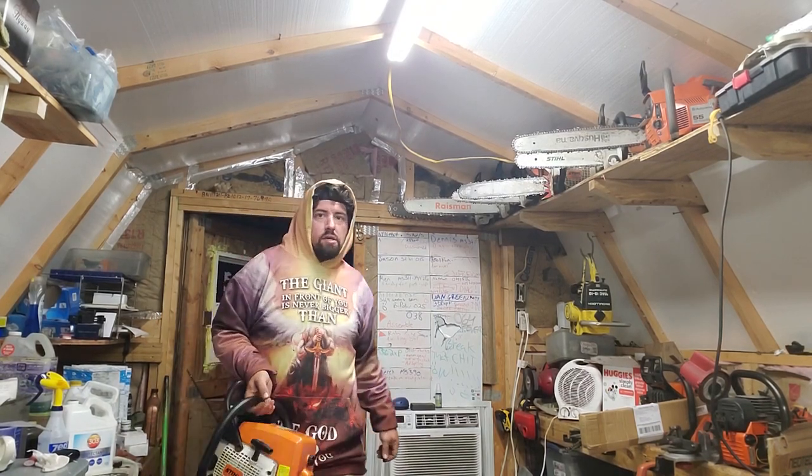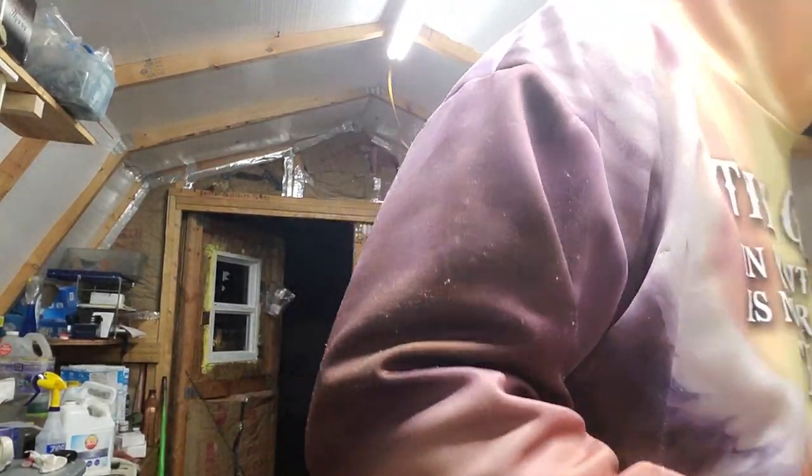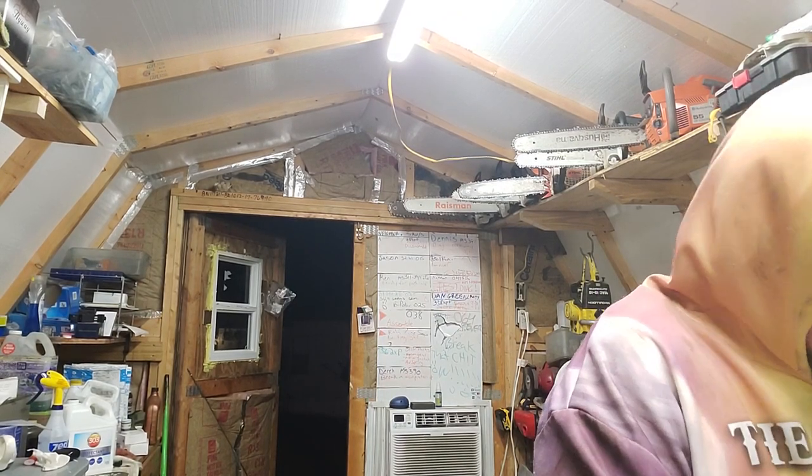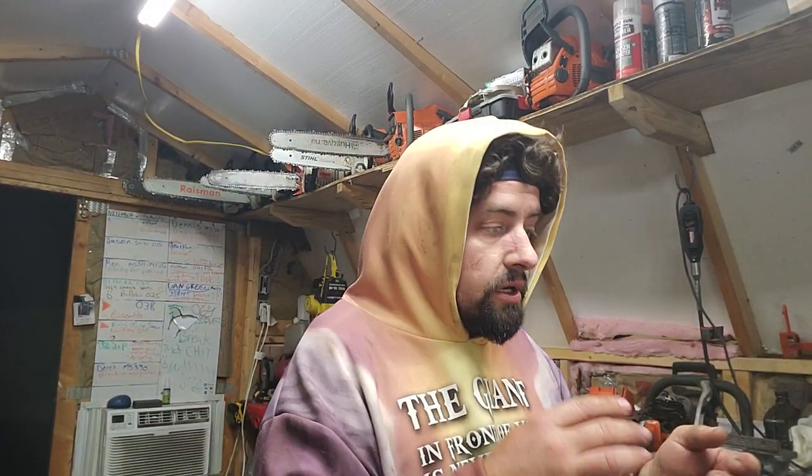Okay, well this saw started before, it just didn't idle, it refused to idle. I might have replaced the rings on this, I wish I could remember. Yeah, new rings, I did, so they do need seated, but this saw won't idle, so we're literally going to start with the diagnostics. I'm pulling the muffler. Does my piston still look okay? That's the first thing I need to know.